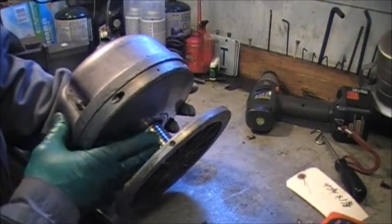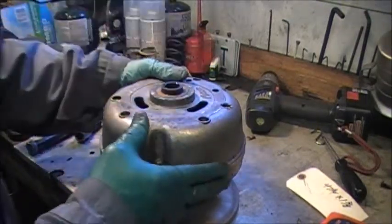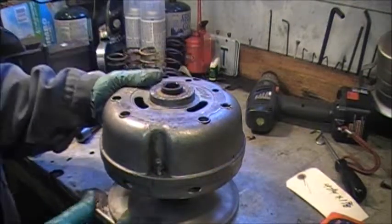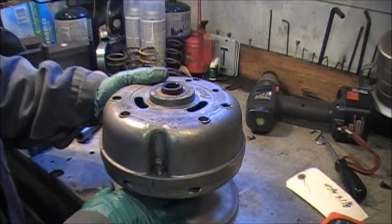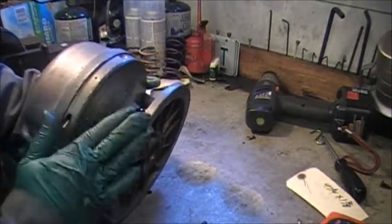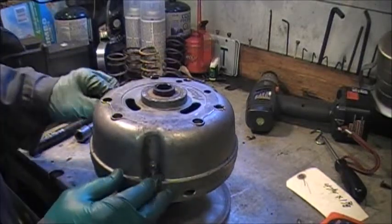And the belt clearance, I've been struggling with getting the right belt clearance. I've got a bunch of Polaris 045 belts that they're all a little bit shorter. I found a 042, which gives me a nice center to center or belt deflection, but it's worn, and what I want to do is take another clutch, set it up for that belt. A little bit worn, and I think it'll be optimum.